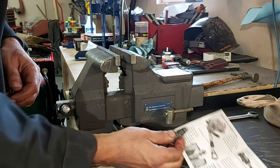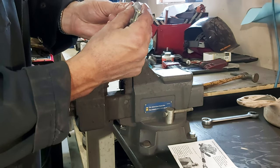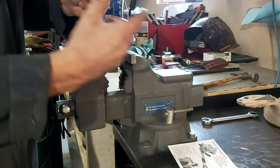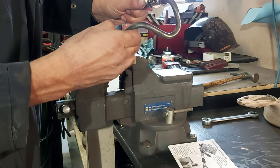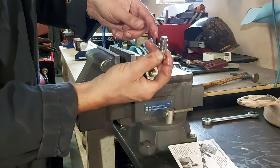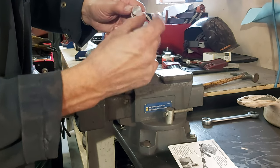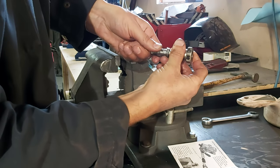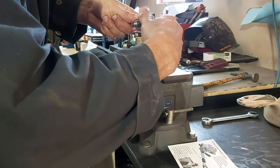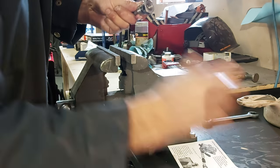That's all there is to it guys. So we've got three shims in here now as per instructions and we'll pop this back in. So how it goes: this goes into the power steering pump first, then this goes in, and then of course our line goes in. So number one, it's now modified with the three shims — number two — and then of course our high pressure line. Now we can use it with our factory rack and pinion on the Mustang.